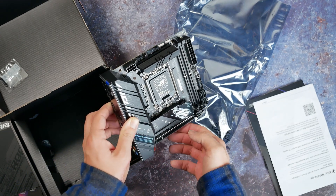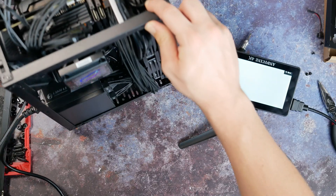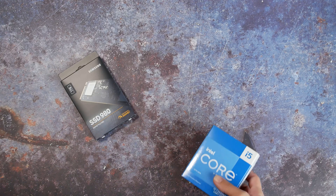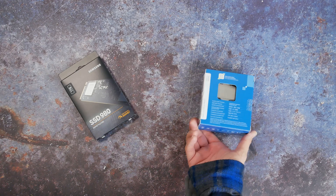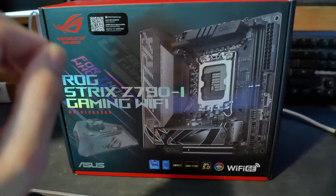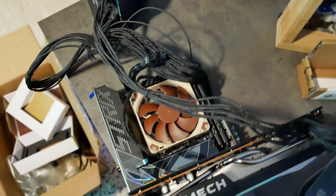We went through two different motherboards due to the Intel chipset not being compatible with the processor. We're getting some sort of yellow light — I don't know if that's good or not — and we're not getting an output either. What we realized is the Z790 ASUS board, which is the more expensive board that we didn't initially want to go with, is the chipset that needs to be paired with this CPU unless you have a BIOS flashback button or a CPU compatible with a different chipset. Since we didn't have a spare processor on hand or the ability to upgrade the BIOS to the new processor line, we had to go with the more expensive board because it came with the correct BIOS out of the box.